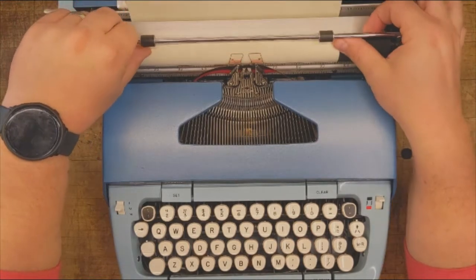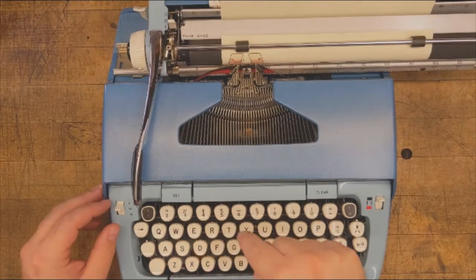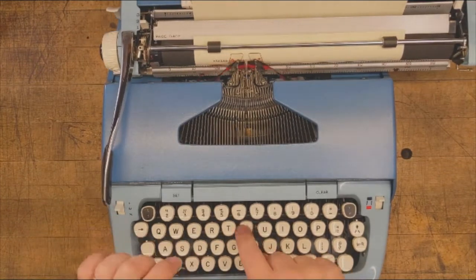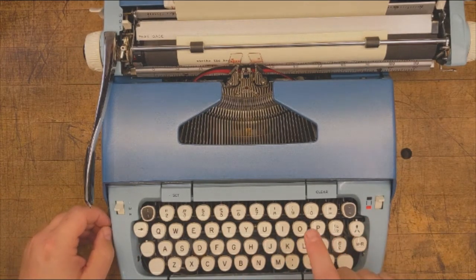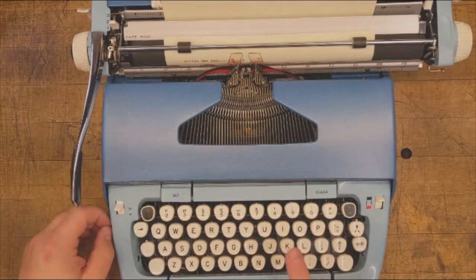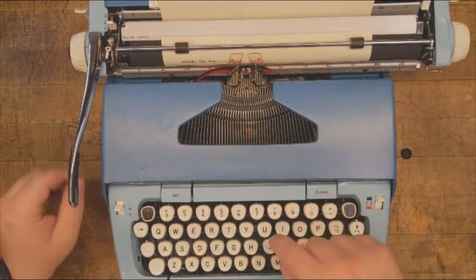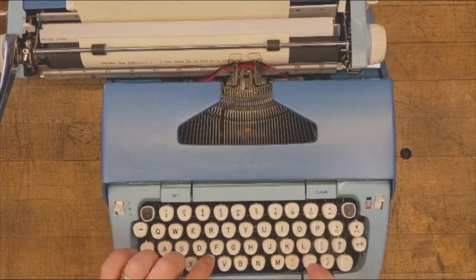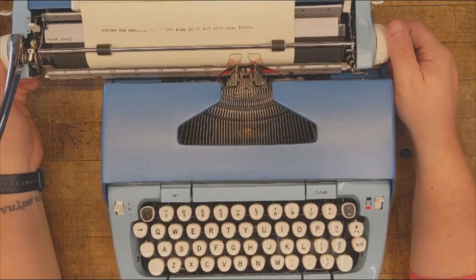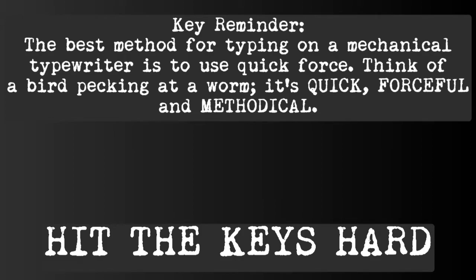Now slide the carriage to the right to begin your first line. Congratulations! You're ready to begin typing. To avoid one of the most common pitfalls of all new typists, you'll want to forget everything you know about modern computing. Modern computer keyboards are built to provide a quiet, overly sanitized experience and can be so sensitive that they are triggered unintentionally. Everything about your typewriter experience is going to be intentional. It takes a certain amount of force to not only trigger a key to make a clean imprint, but it has to be hard enough to cause the key bar making the imprint to bounce back to the resting position. In short, hit the damn keys. You will not break it by typing. This I promise.